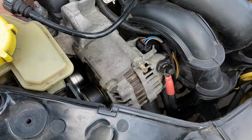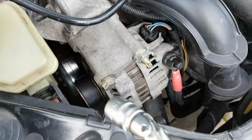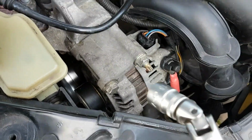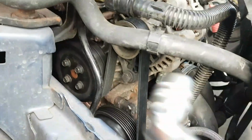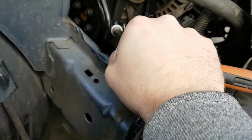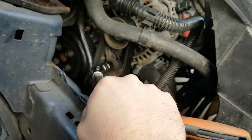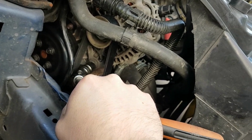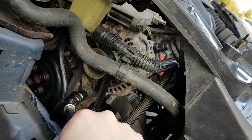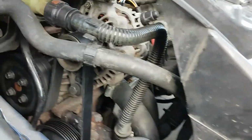So once you've got these top two bolts located and they're screwed in pretty well, don't tighten them really tight just yet. Just before you do that, tighten this one up so it lines it all up nice and clean first, and then once you've done this one, tighten them top two up. Obviously someone might have to get at this one day, so don't swing off it like a monkey, just get it nice and tight, and that should be it really. There are 3 bolts on here, so it's pretty secure as it is, but don't be going nuts with it, just tighten it up as tight as you think, and you should be done.